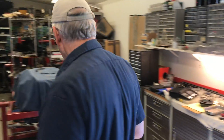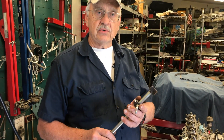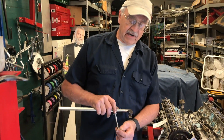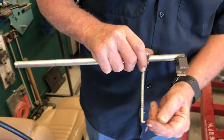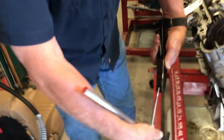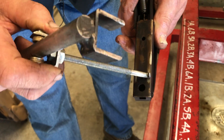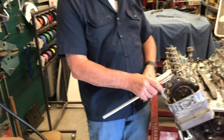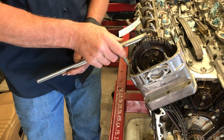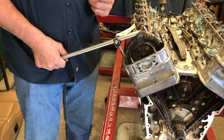This is a reasonable facsimile of the Jaguar tool used to latch the tensioner. It's got a hook right here which I made out of a carriage bolt — I cut the head down and bent the point over to make a hook. This hook goes into the big hole on the tensioner. Remember that you can see where this has been sliding back and forth in a track. You reach in, engage that hole in the tensioner, then use this U bracket made out of square tube as a fulcrum to pull up on the tensioner and stretch it out so you can latch it.